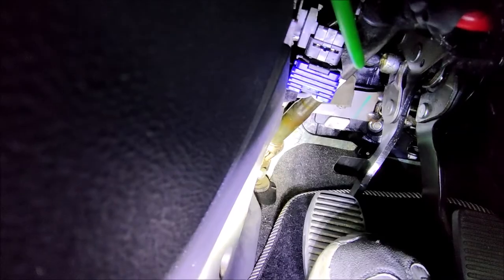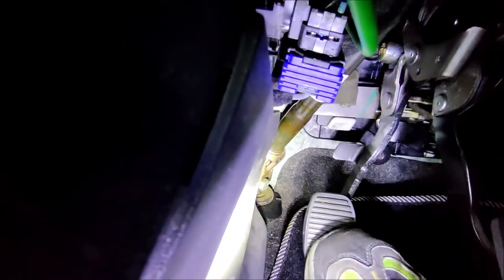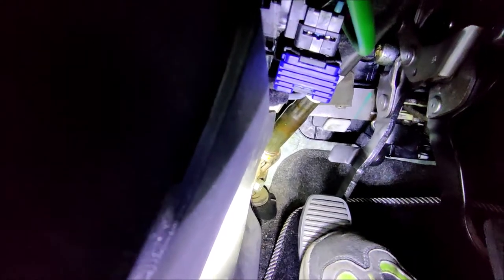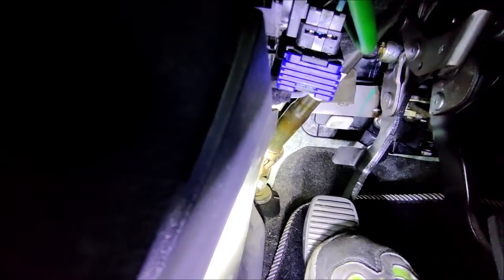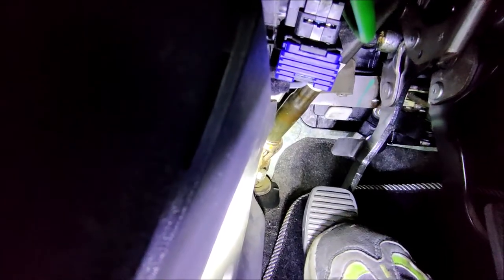What I'm kind of hoping is either the master or the slave cylinder that's making this strange sound. Now I'm going to try and show you the sound. So here we are down in the footwell on the clutch pedal - if I press it down, can you hear that? You can feel it, it's a bit sticky. Now I'll show you the sound in the engine bay.